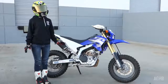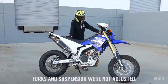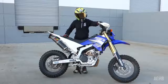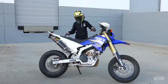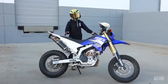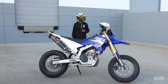Typically every single dual sport or off-road bike is going to be significantly taller than a sport bike. I'm really short for this bike. The stock wheels are bigger, so I changed these to be a supermoto-type setup — the front and rear rims are size 17 each. These specific tires I got made it an inch taller, but if you get street tires like I used to have in my previous videos, you should be okay.